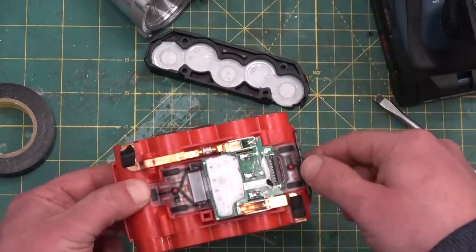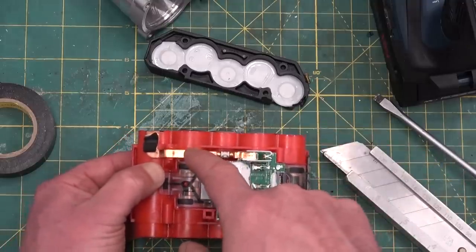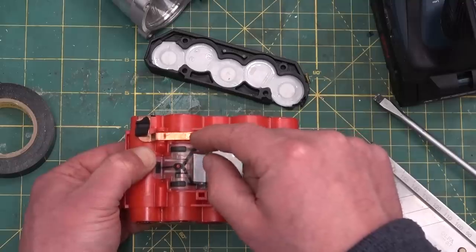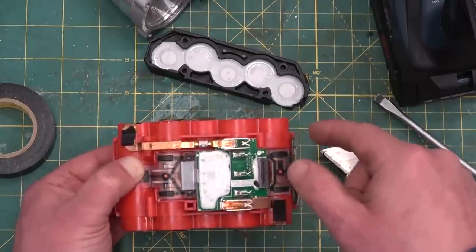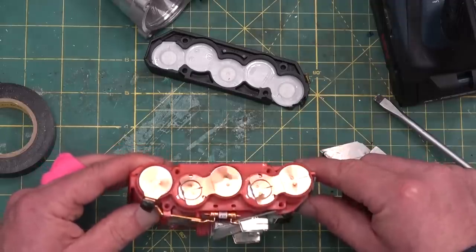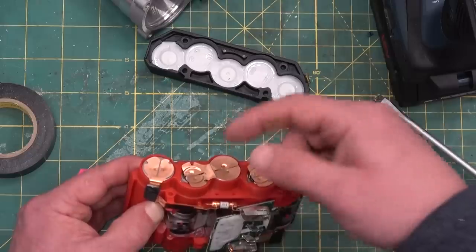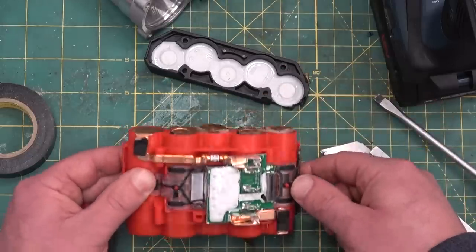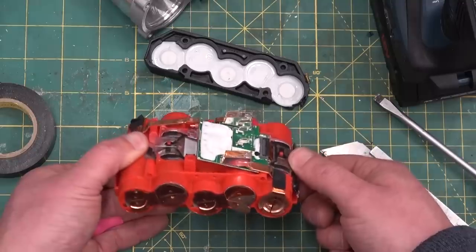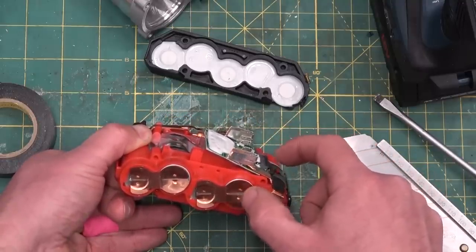Vertical integration. We're using a Robert Bosch fuse. Instead of a fusible link, where the nickel ones are real thin in one spot and that's what melts out and protects the cell, we have a proper fuse. Still, why are they using just a foil? Now, copper, of course, has much higher conductivity and ampacity than nickel for a comparable cross section, but at the same time, nickel doesn't have the problem of work hardening.